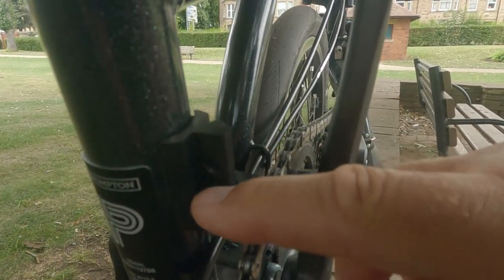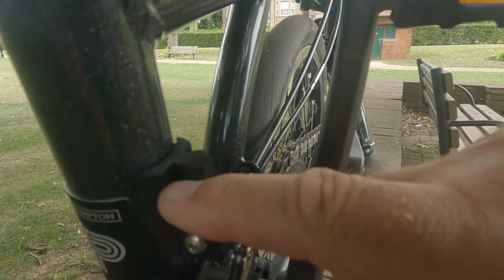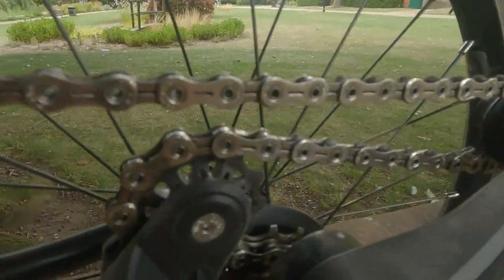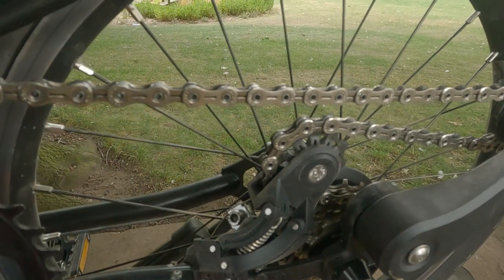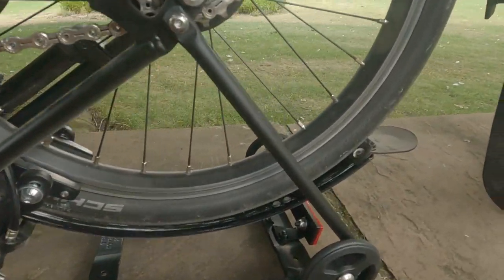The little part they call the chain keep has three threaded holes, so you've got three positions — I think that's 44, 50, and whatever it came on, and 56. The first gear is now a 19-tooth instead of 18-tooth — I may go to 20. Even one tooth difference has made a difference to the rideability of the bike.